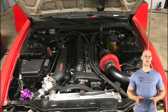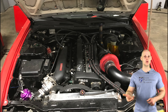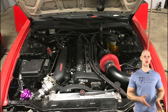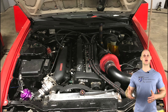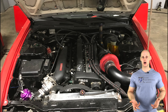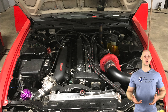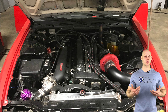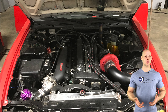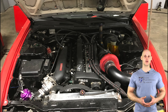We also have a couple of other sensors. There's a flex fuel sensor installed in the fuel system. We're going to be doing a flex fuel base tune — tuning on 93 octane and also tuning with ethanol, cross-blending and calibrating the fuel, spark timing, and boost control based on ethanol content. We also have a fuel pressure sensor, a boost control solenoid, and a wideband, all used in our calibration process for closed loop fuel control.